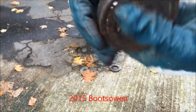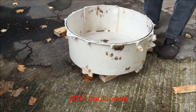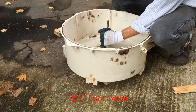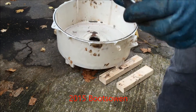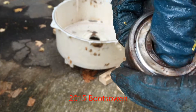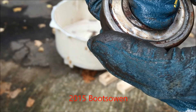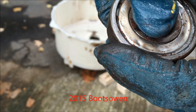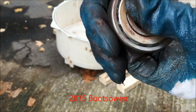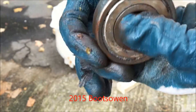So I'll drive out the other one — and even though it will have been hit with a hammer and probably be better not to use it, I'll show you what it looks like. And that's this one, and even though it's been — oh, I can feel it now — it's gone as well. But if you can see just along here, there's a bit of play in that one as well. Some of that could have been from me bashing it out. You're meant to press them in gently along the outer rim, but getting them out you just have to force them out. So that's how you get your bearings out, and that's what a bad bearing looks like.